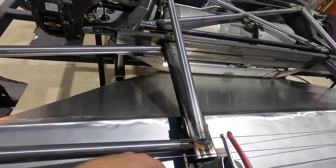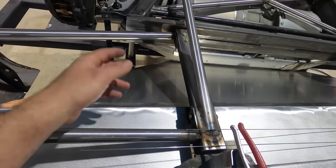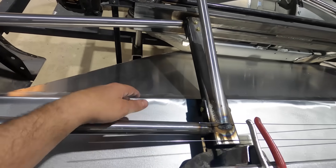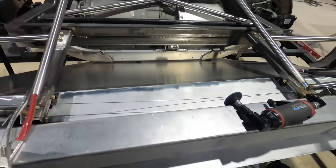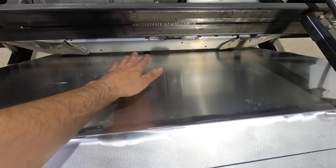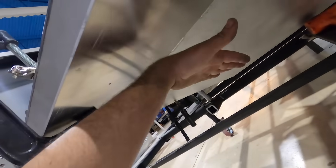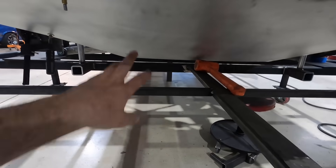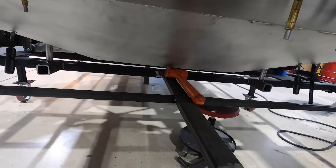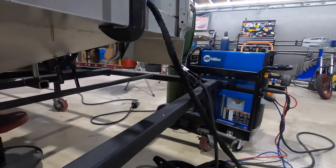Our diffuser is taking shape. I have it back in the truck and I'm going to weld the backside of the down plate on this diffuser, because on the bench I just couldn't get it exactly where I wanted it. I have some nice long slip clamps on the sides pushing up against the Tesla subframe so I know exactly where the pitch is, and everything's clamped in place real tight. When I welded the underside on the bench it moved a little - it was supposed to be at 35 degrees, now it's at about 42 - but we'll weld the top side and it'll pull it back up. Once this is set we're going to start making our slats.